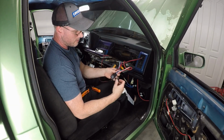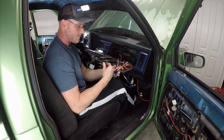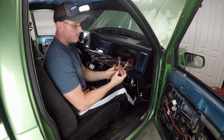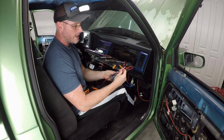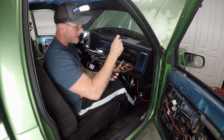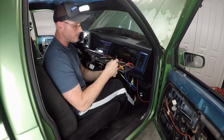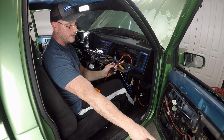So on each relay, on the ones that I bought, if you're using the same ones that I purchased from the link in the description below, that's going to be these. They have blue, black, white, and red. So the white and the red are going to be 12 volt constant coming from the battery. The black is going to be your switch coming from the shaved door handle kit. And the blue is going to go into the solenoid in the door.